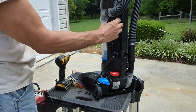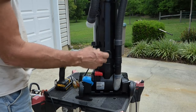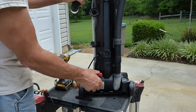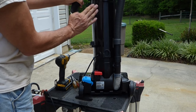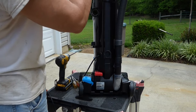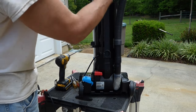Because it wasn't pulling it from down here. You just turn that an eighth of a turn counterclockwise and it pops off. Now we'll check and see if it's pulling air — it should pull through here. And it's got good suction, so I imagine there's a clog somewhere in this hose.